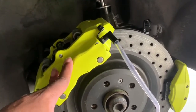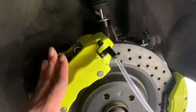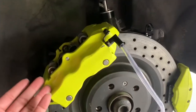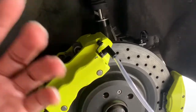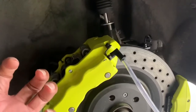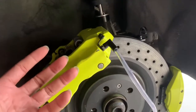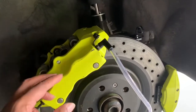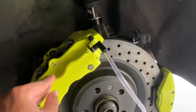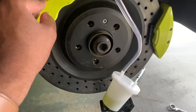You can do just one caliper, but to keep it safe you want to do all four, and always start from the one furthest from the master cylinder. That's pretty much how you stop mushy brakes — whether you just had a brake job, had a leak, or your brakes aren't firm and you're not stopping immediately. It's good maintenance, especially if you're tracking your car. This is a safety tip from Bruce — thanks for watching, please subscribe.